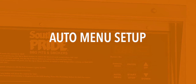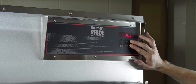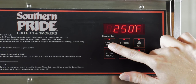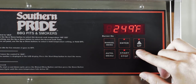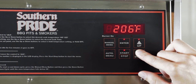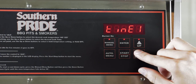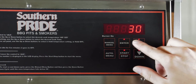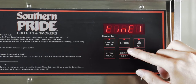To program an automatic menu preset, the control should be in the idle position. Press and hold both the up and down arrows for 10 seconds. Automatic menu 1 will be displayed. Press manual menu to enter the setup. Press the manual menu button to select temperature and adjust the cook temperature with the up and down arrows. Pressing enter will save your selection. Press the down arrow and press manual menu to select time. Adjust the cook time with the up and down arrows.